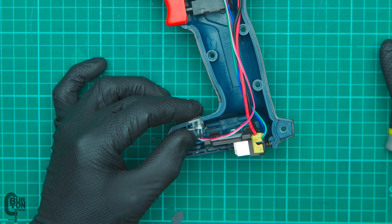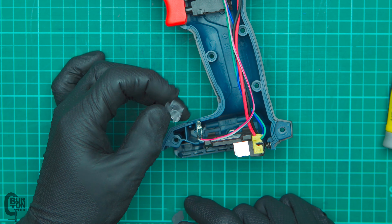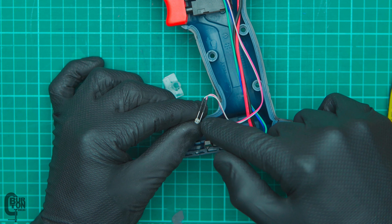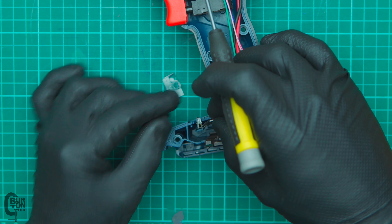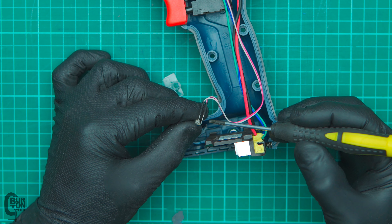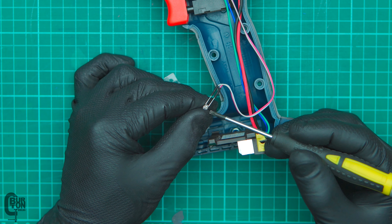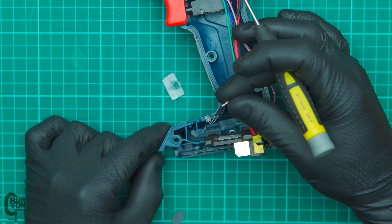This little LED light looks a bit light in the pants. If we pull the little reflector out, we've got just a little transparent reflector that slides into the case. But have a look at this — my goodness. We've got a really small little LED with literally just the wires soldered onto the legs of the LED. Not too impressed with that. In most of the tools I've seen with this type of setup, the LED is onto a little circuit board. I'm guessing with a bit of vibration, these little legs can break off fairly easily — quite a lot of leverage on them — not too impressive. But hopefully we never have problems with that.